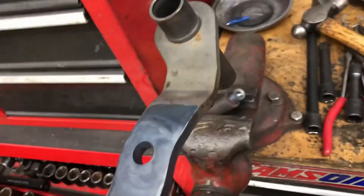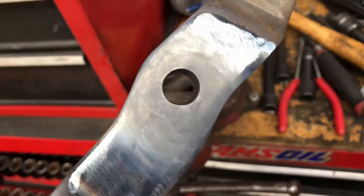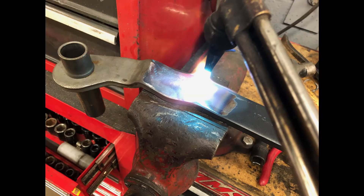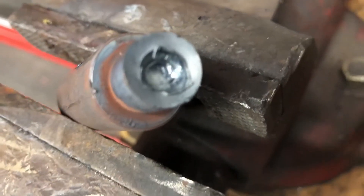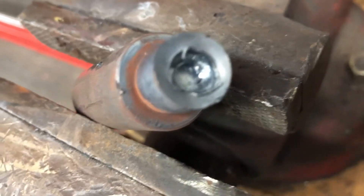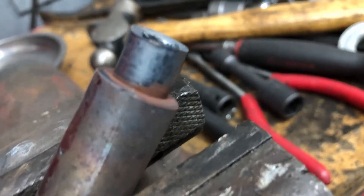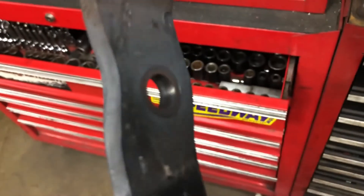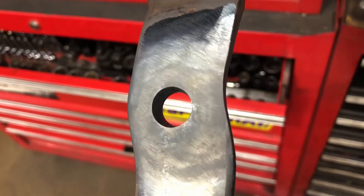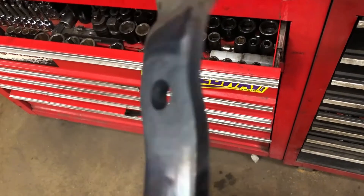This piece is hotter than hell so I'm going to cool it down. What I did is I heated this up till it was cherry red and drove that pin right out. You can see how far the head of my straight air hammer bit went into there — that is very, very soft metal. You can see how it's swedged out on the end. If you measure that hole, it's actually tapered — that's a pretty good mechanical way of keeping that pin anchored.